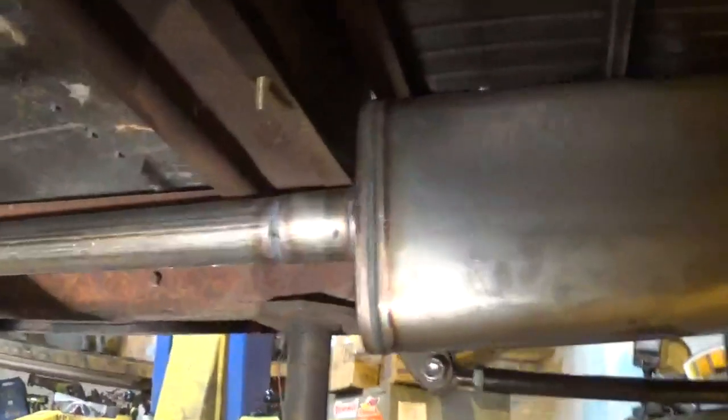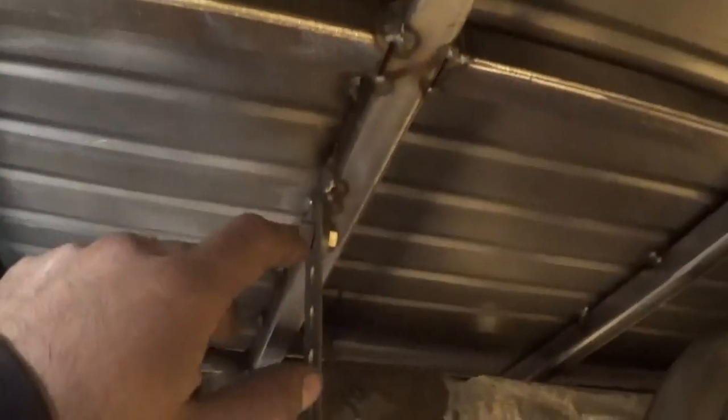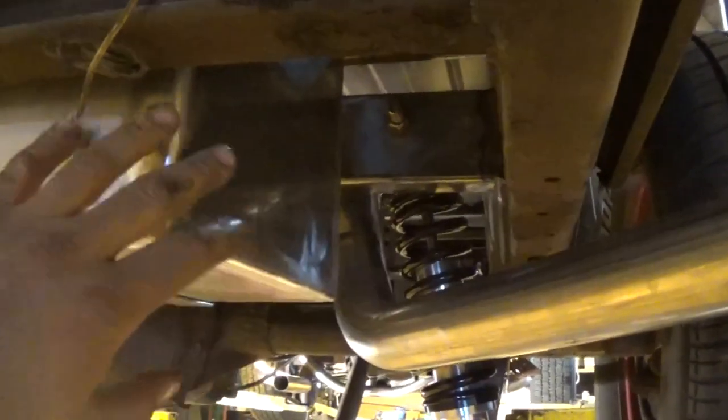So this is where we're at so far. I got my muffler in position and got to go to weld up on the front there. I also put a hanger on the back side - got my clamp to hold that up, cut a little tab, welded it off to the framing on the bed, and bolted the hanger on. Originally I wanted to run them straight out the back here next to the tank but that's not going to happen - I don't have quite enough bends to sneak around because my fuel cell is hanging low and the four-link makes it tight. I got about a quarter inch between my upper bar and the pipe - this bar can only travel upward from here so it'll never go lower.